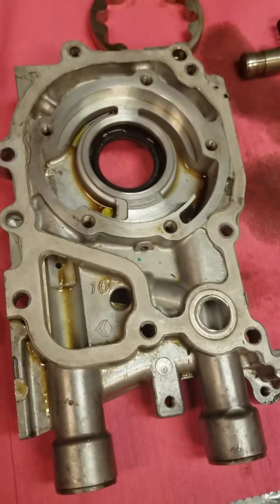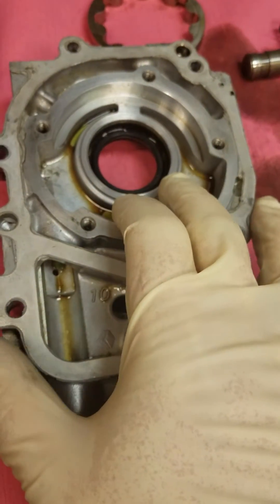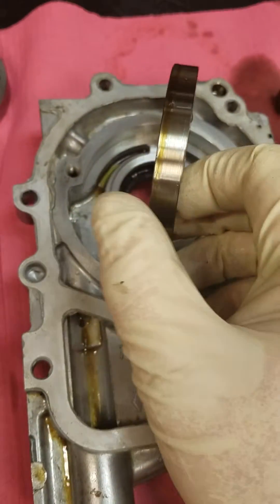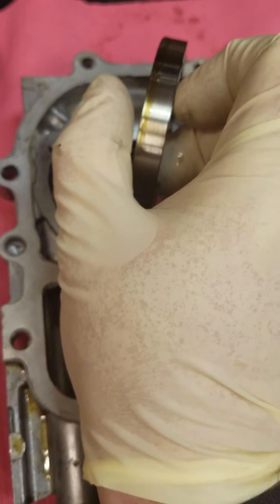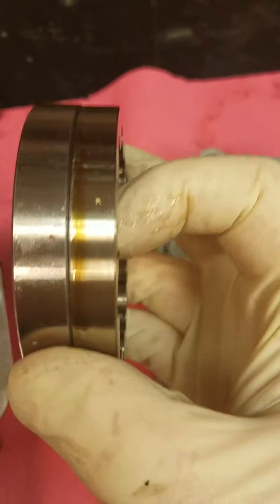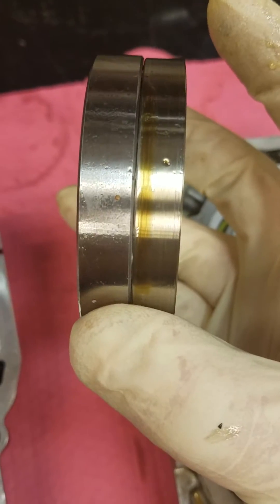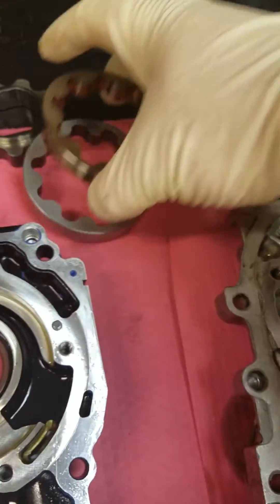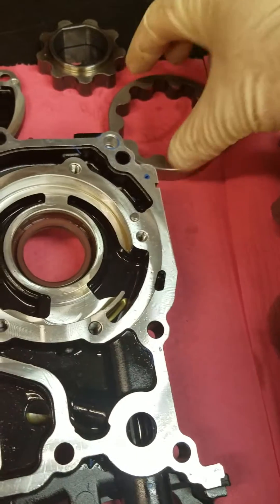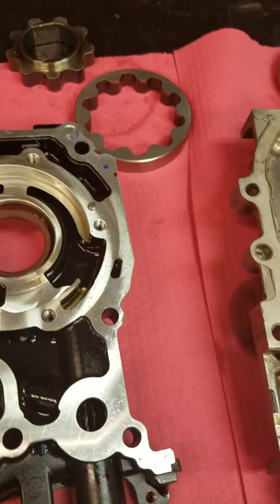Let's talk about the 10mm pump so you guys can get a baseline. When they talk about the pump in millimeters on a Subaru, what they're talking about is the rotor thickness — the actual dimension of this rotor right here. If we put the ACL and the OEM together, the OEM being on the right and the ACL on the left, you can see a drastic difference in size. The larger size allows the pump to pump more oil since you have more surface area to use, which increases efficiency quite a bit.